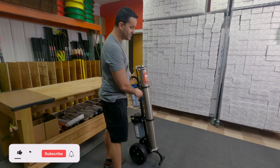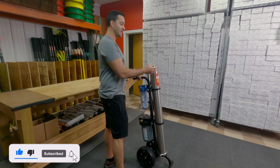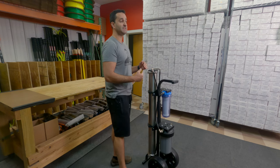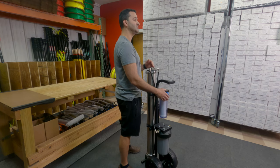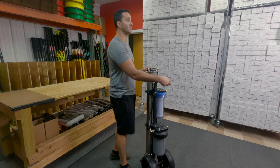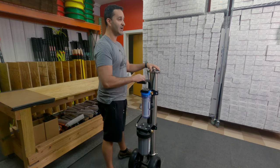Right up front, the Tucker Rival uses a stainless steel RO housing — a little bit lighter than the S4's fiberglass housing. If you spin it around, you'll notice that it is a three-stage filtration system. You have a carbon filter up front, which will also catch sediment as it comes into the system, as well as the chlorine, before the water travels to the RO membrane, and lastly out the DI cartridge.